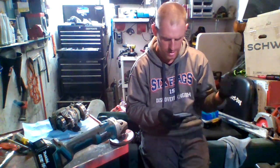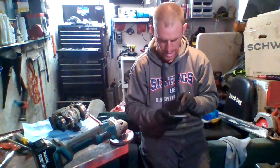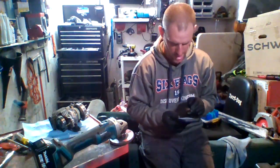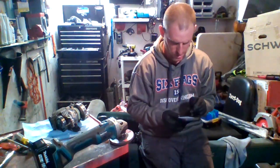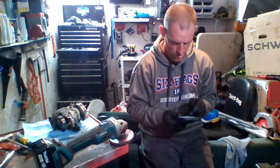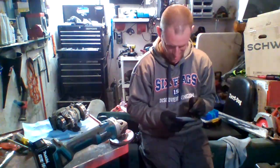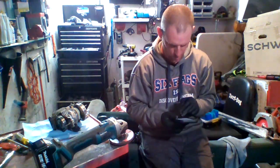Spark plug type, I don't need to know that. I already know it. Well, in case you guys want to know, it's an AC CS45T. Spark plug gap is 0.63 millimeters or 0.025 inches. Crankshaft main bearing is cage needle roller. Fuel oil ratio is 40 to 1. Oops. Oh well. Recommended fuel octane, regular grade.